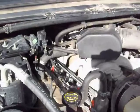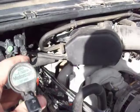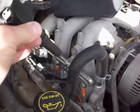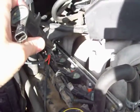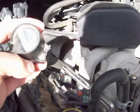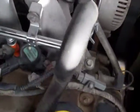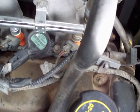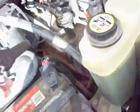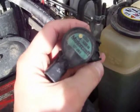So I've already pulled the — felt around back there, so I know that's what's happened. I found the spark plug back there and I found the coil. These are coil-over-plug ignition. You can see the coils down here: 1, 2, 3, 4 back there, and then number 5 is way in the back. When it blows, it blows the plug out and busts off this little tab over here where it's screwed down. You can see the coils are screwed down to the manifold, and when it blows the plug out, this coil is over the plug — blows the coil out and busts off this little tab here.